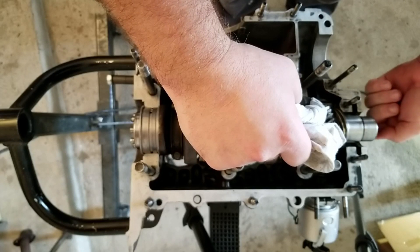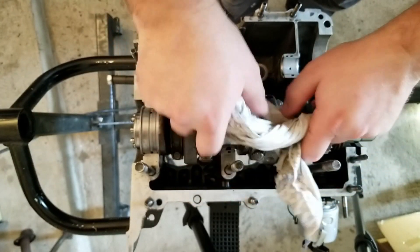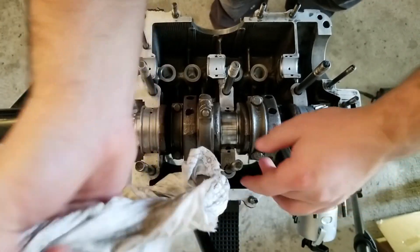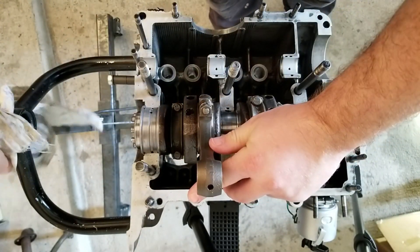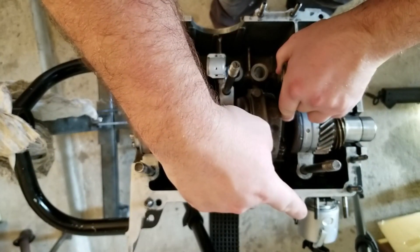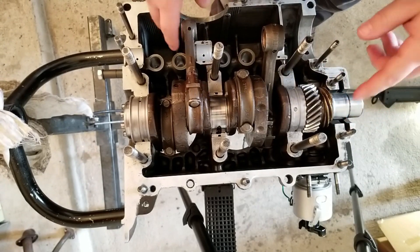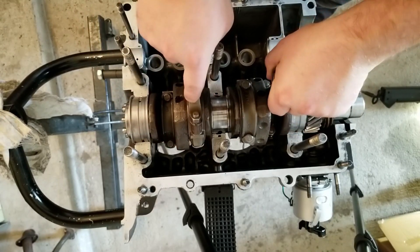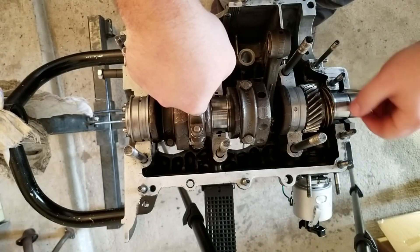Once again you want to check your reference point on the front — your woodruff key is pointing down, which it is. We are in position. If I go to turn these rods and pull the handle out, it falls into the seated position. You should start to see the rotor turn as I'm rotating the assembly — see it moving. Now you know that you've got your crank and distributor drive all the way down in position.